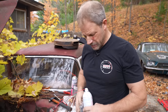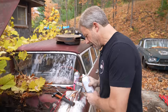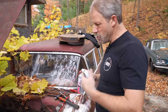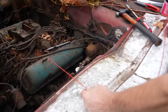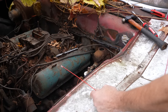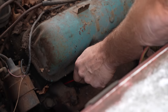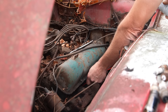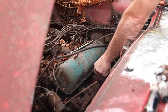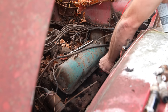We're going to put a little lubricant in each cylinder — this happens to be Deep Creep, something I grabbed off the shelf at Thoroughbred. We'll put it in each cylinder; it'll help lube things around as we're trying to turn it over with the starter. I've got this fancy wand — down the hole, two, three, four, five squirts per side. You can never get a can down there, even with the nozzle that comes with it. That's why these wands are so nice to have.